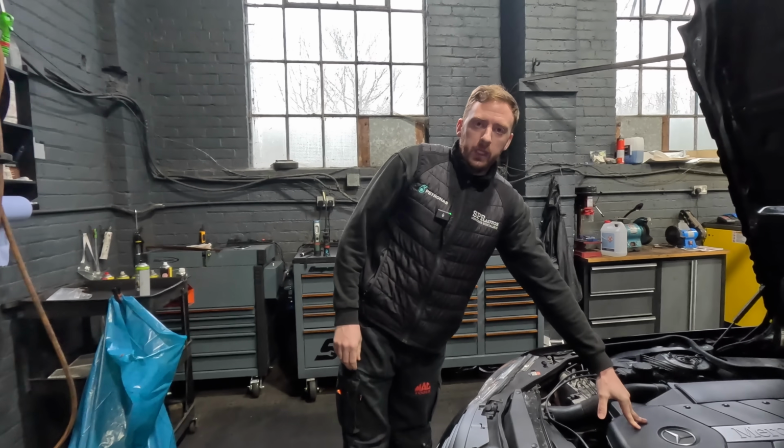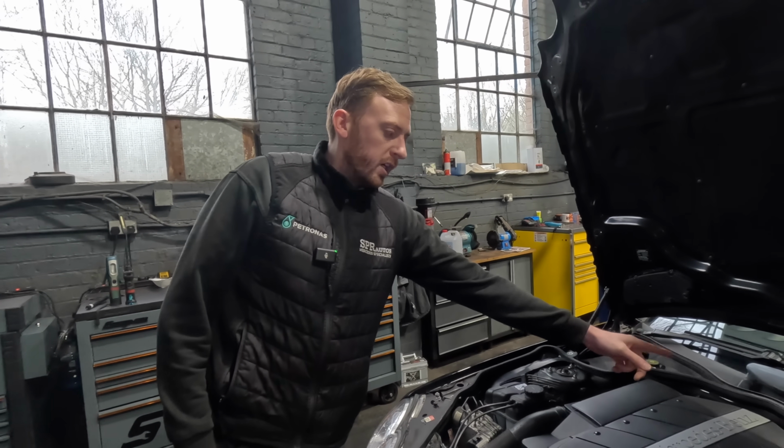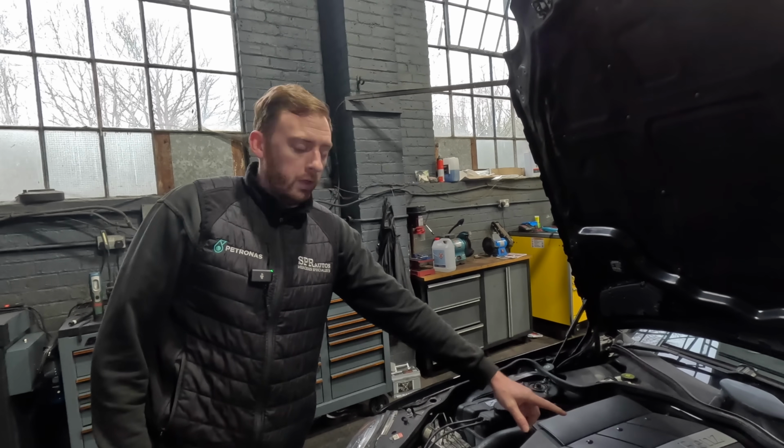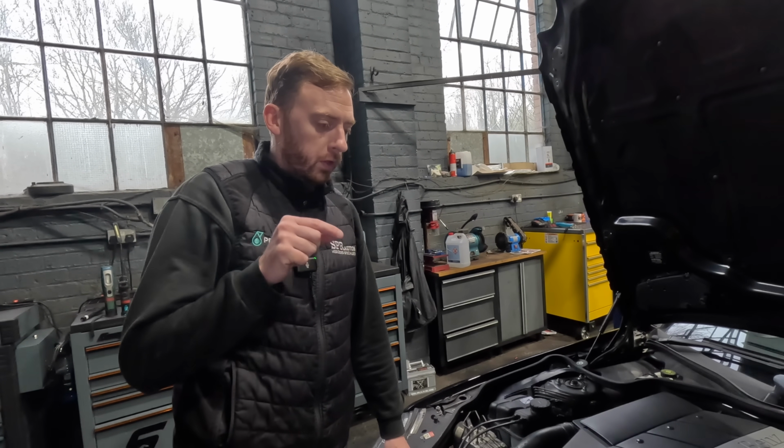Just to cover a few basics on the M113 engine, most common faults are probably crankshaft sensor, rocker cover and breather boxes leaking. I'll put a link in the description below for us doing that job on another vehicle.